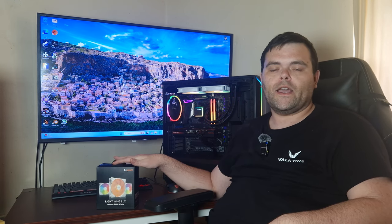Whether you're into RGB or not is completely up to you. But the best thing about RGB is that it's controllable — you can set it however you want. For controlling these fans, I used MSI Center on an MSI X570 Pro Wi-Fi Carbon motherboard. You can also use Signal RGB. If you're going to daisy-chain these, make sure you plug the last connector into a 3-pin header on your motherboard.